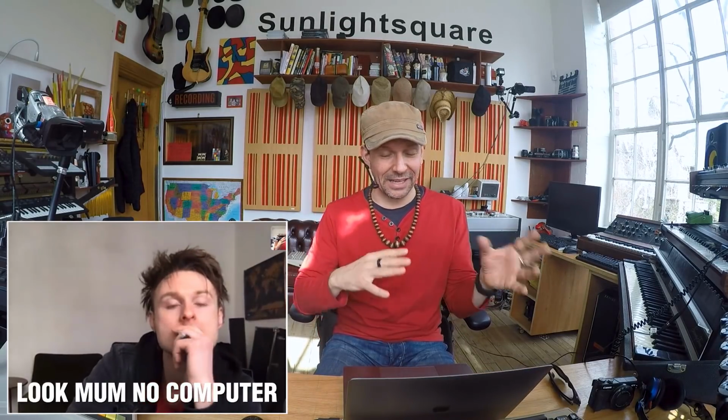So basically, I've been experimenting a little bit. I have found some interesting monitors, like a display, which works great. Here I go with my first question. The Commodore 64 that we've modified is the bread bin. It turns out that the video signal is not so good. Sometimes I get a black and white image, sometimes a jumpy, blurry image, as opposed to the white, more modern one, where I get a much better video signal.